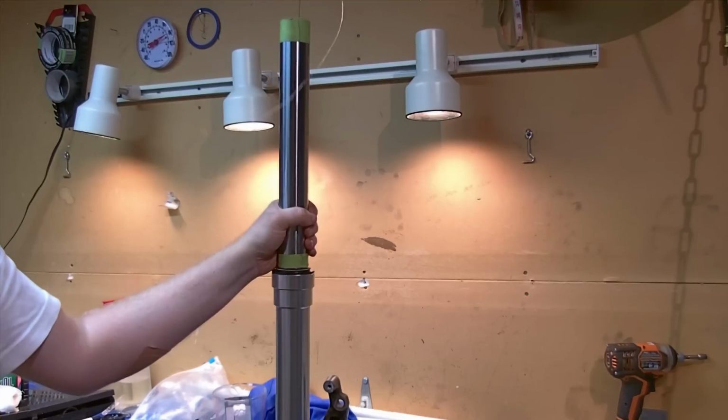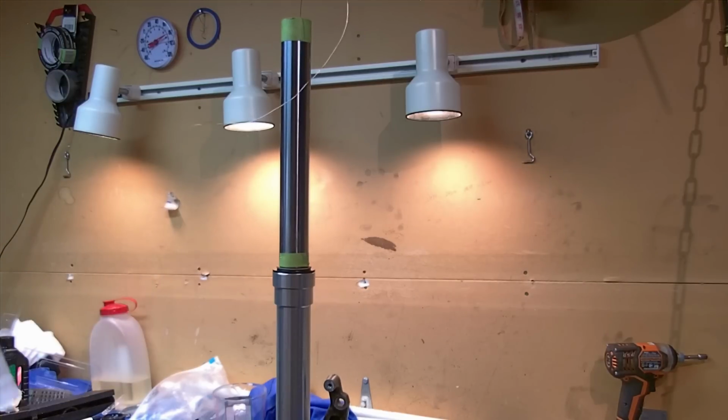Let's call that good. Now we need to let that sit for 10 minutes and let any air evacuate from the system. We'll look down into the tube at our oil level and make sure we don't have any bubbles forming, but this should be bled per the factory manual specifications. I'm going to let it sit 10 minutes and we'll catch up then.